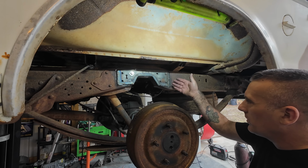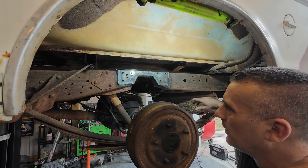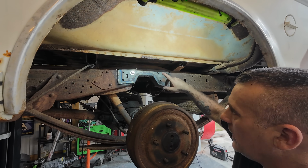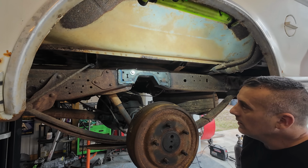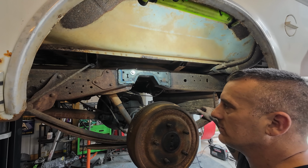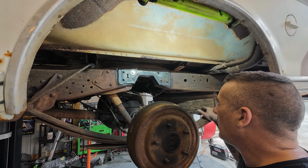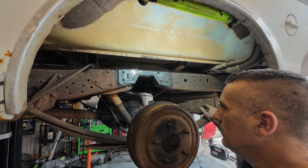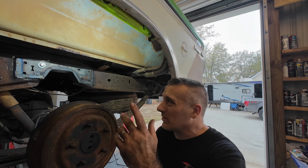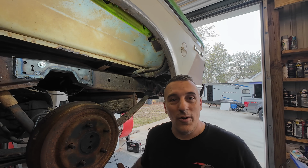This is it, it's welded up. I could come in up top with a weld, but I probably won't. This is gonna be fine. It's better than these 8 bolts that would normally be in here. So I'll probably plug weld this one up here in the corner as well, but outside of that, guys, that's perfectly fine. That weld penetrated real good and I don't have any worries with it. I may come in and touch up some stuff a little later off camera, but for the most part, this is it. Our frame is now C-notched and the truck is low, it looks great.